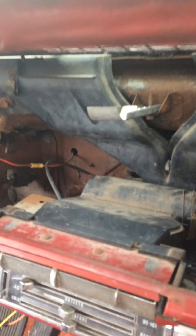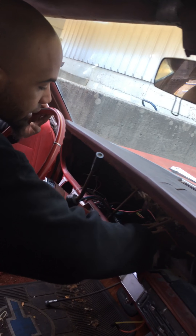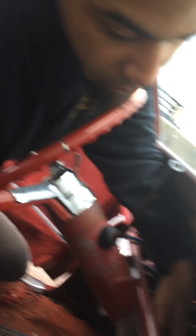With the new factory wiring harness in there — the main harness — things like the defroster and heat controls also run through it. These lights hanging down go on each side, and the defrost and heat are hooked into the harness too, because those old ones looked a little toasty. What's great is this harness comes essentially pre-wired with all the factory plugs — it's just plug and play. You plug it in, everything is already wired and connects right into everything factory. No cutting, no nothing — just route it how it should be from the factory.